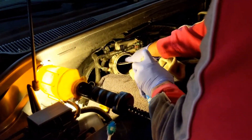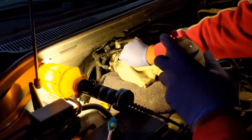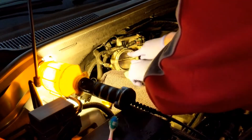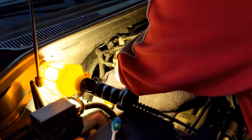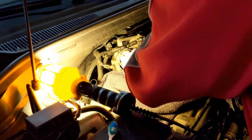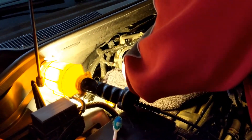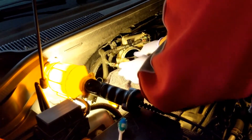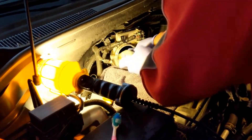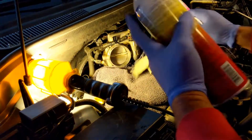It's pretty easy — just give it a couple good sprays in there, make sure that we get it nice and clean. This will help with acceleration if your car's having any kind of stuttering issues. Having a nice clean throttle body helps. And if you're ever having to take off the cover and the air intake tube anyway, might as well just go ahead and give this a nice good cleaning — something to do every once in a while.